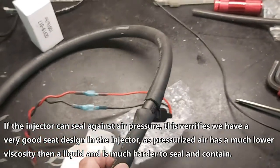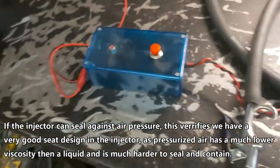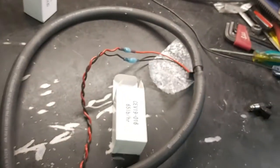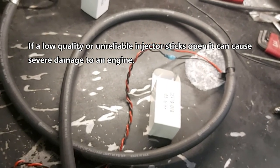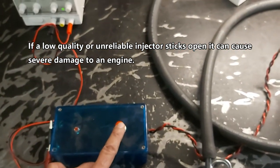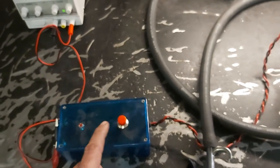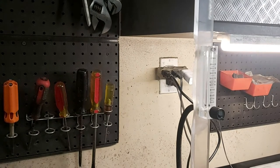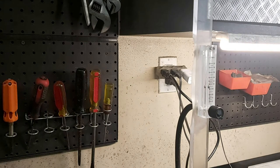I'll put the camera in the holder. Here's my tester — basically what you do is just press that and you hear it click, so that's opening the injector. I've got my pigtail for the EV14. As soon as you press it, it clicks — you're opening up the injector. The pressure is applied and I'm just going to trigger it. You can see the ball goes up to 100.